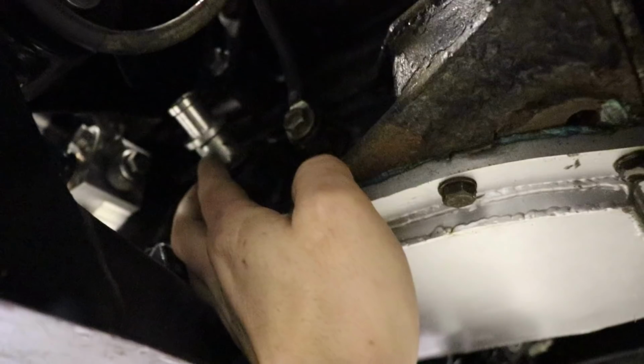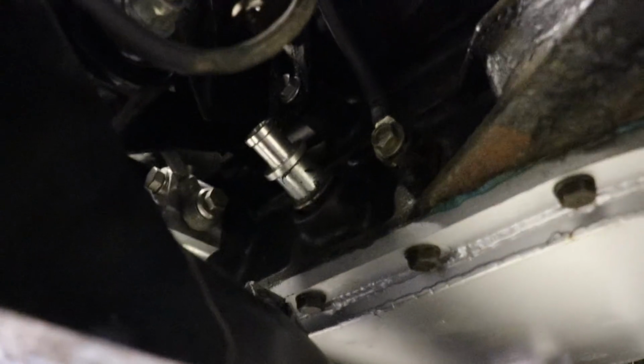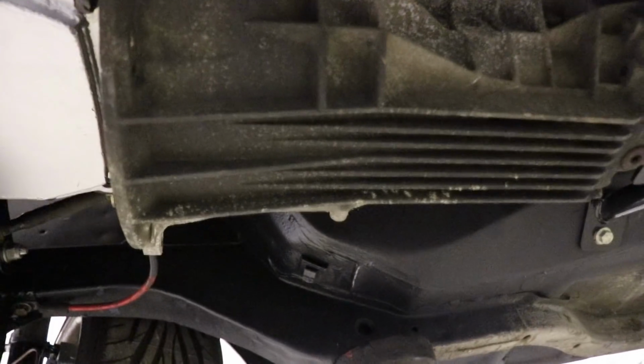So yeah, I just want to wrap this bit here. We're going to wrap the top of this just because I've got my clutch line fairly close. It probably wouldn't be an issue, but I'm going to do it anyway. And then this is my drain. I made this little bung to fit in the end of this piece, which is where the original drain connected to. I needed to step it down to the same size as the drain on the bottom of the turbo. So I've just got to get a pipe from that up to the bottom of the turbo, and then that pipe to the top of the turbo, top coolant hose, some vacuum lines, and that is all the pipework and plumbing done. Then we can fill her up with oil.